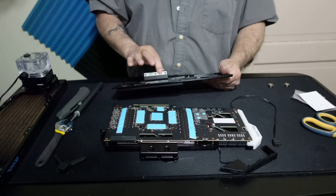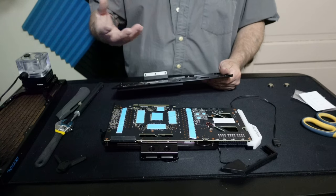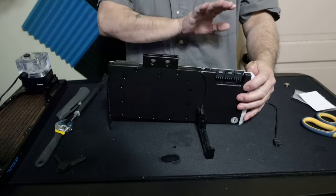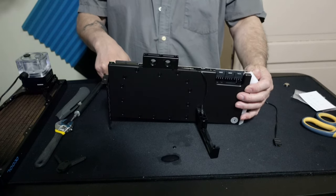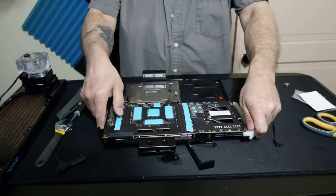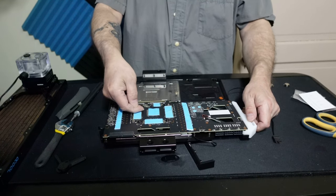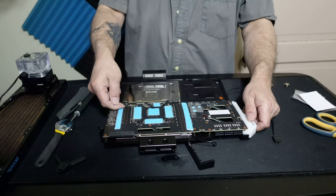This plate I'm pointing at right here holds the O-rings — there are little O-rings in there that seal off the water. On the main water block attached to the card there are going to be two O-rings. The screws that go into this are 2.5mm, I think 7 and 8mm long. The center takes a 1.5mm thermal pad, four around the GPU area use 1mm, and the two at the end are 2mm.